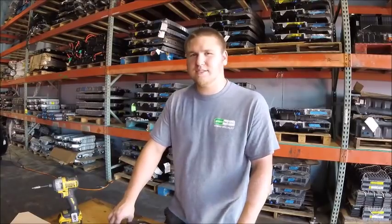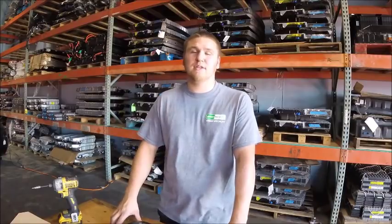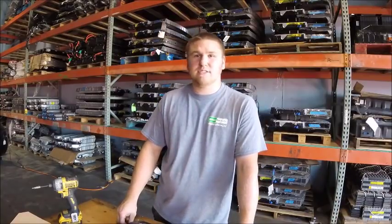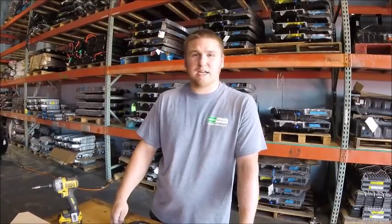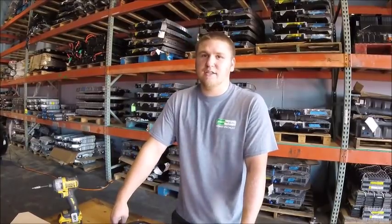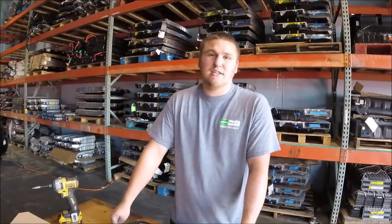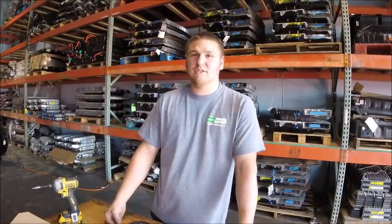The problem with this is that these cells, again, are almost down to 0. They're in the millivolts range, and you can't necessarily revive lithium-ion batteries. Once they're gone, they're gone. Now you can definitely charge them up and get voltage and get capacity out of them, but from what I've read online, it definitely messes with the internal chemistries of the cells, and they're actually no longer usable. It changes the chemistry inside just a little bit, and enough to where it's no longer safe to use.